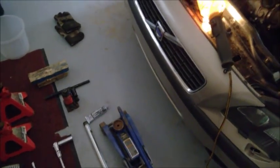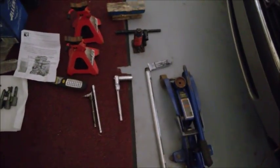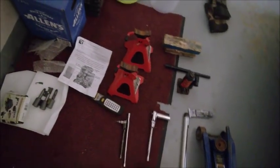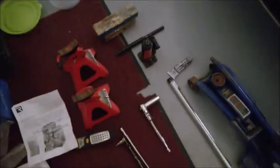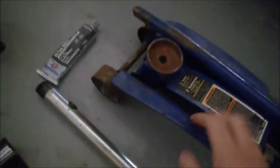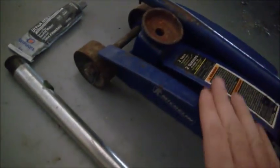This is going to be a video in three parts, I think. In the first part, I'm just showing a bit of the material I will need to use. Stands: I will need to lift the front of the car on both sides, remove both wheels. I will use the hydraulic lift, I'm going to slide it underneath the subframe. At a certain moment I will explain why.